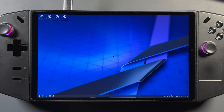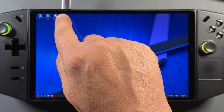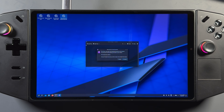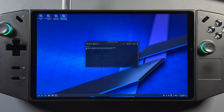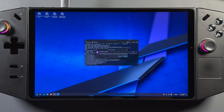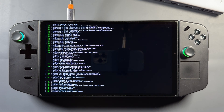It's going to start its process of booting into a desktop mode for SteamOS install. Once it gets there, you've got four options at the top. You're going to want to use the one that says 'Wipe Device and Install SteamOS.' Everything is just one tap — no need to double-click. It's going to warn you that the entire device will be wiped, so be sure you want to do that before you hit Proceed. Then it's going to install SteamOS. It only takes a few minutes, and once it's done, click Proceed again — that will kick it into a restart and take us into SteamOS for the first time.